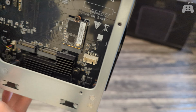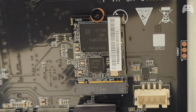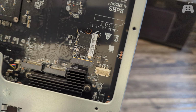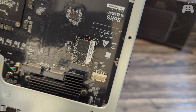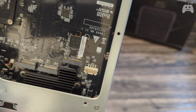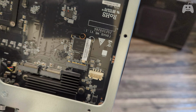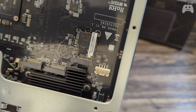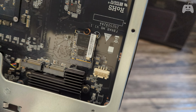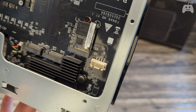Next up, I'll pop the fan off of the other side and take a look at the SSD that I was given as the boot drive. Look how little. It's almost adorable. Not too adorable knowing that they're going for a cheaper SSD in these machines, you know, due to the current market, but it is what it is, I guess. The 64GB stick, a Samsung CKTM4R, which actually apparently is more of an eMMC thing. I'm quite unfamiliar with that, funny enough, but whatever the case, will likely be plenty for any OS that I would use with a NAS, so it's probably fine.